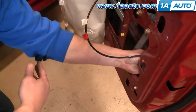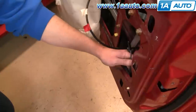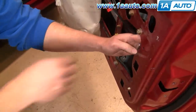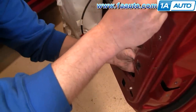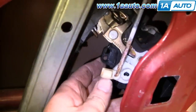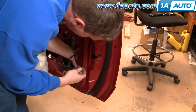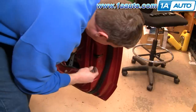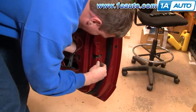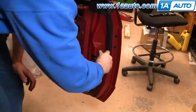The mechanism kind of spins around. Retrieve your lock rod and make sure it comes up through correctly. Push it into place — got the lock rod back in. Push this around and lock it on. Now put the lock mechanism into place, line it up, and put all three bolts in place first, then tighten them up nice and snug. You don't want to over-tighten them.